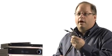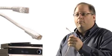When connecting devices that use analog cables, we're also going to have to send audio to the AVR. We can do that with one of three types of cables: an analog audio left and right cable, a digital cable that's a coaxial design, and also an optical cable. Some of the most advanced AVRs from Harman Kardon also utilize network cabling. We do this to connect the AVR directly to the Internet so that you can pull down Internet radio stations and other content that you might want to listen to or watch.